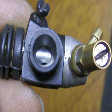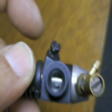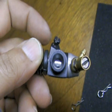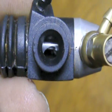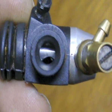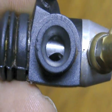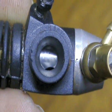You can increase or decrease this gap by using the idle speed screw, or you can also adjust your carb throttle arm, which actually connects to the servo. Remember one thing: if your carb is open more than it should be right after you start your truck, it will rev and it will try to take off. So whatever steps you take, make sure to put this gap down to one millimeter.